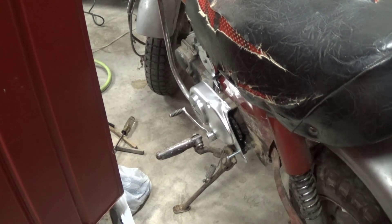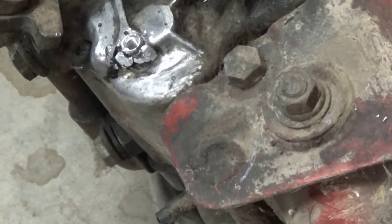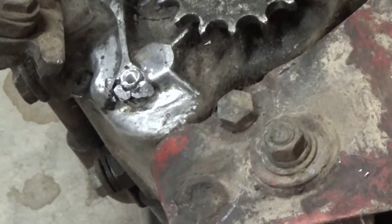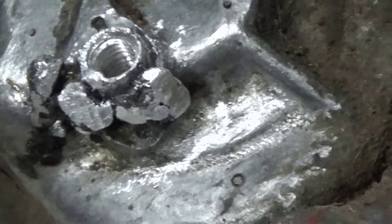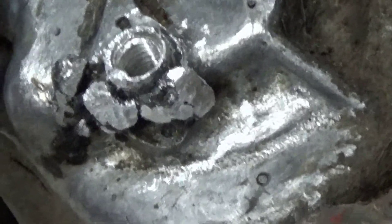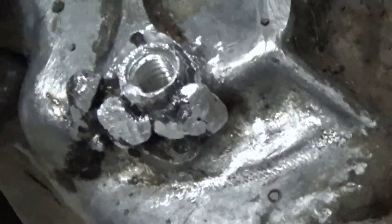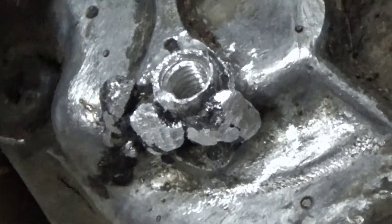The next thing — my part I'm going to weld; on your part you could be JB welding, or I'll put those rods in the description. Whatever means you're going to use to bond this thread to the crankcase, you're ready. Okay, I migged it in — and that's more like spot welding, even though I made those big balls. I'd have to play with the welder to get it to weld a little bit better. Looks like a dirt dauber's nest. But if those rods come in before I have to take this bike back, I'll show you how you can flow that in. That's actually got it held in there — I've put a bolt in it, pulled on it, and it wouldn't come out. It's in there.